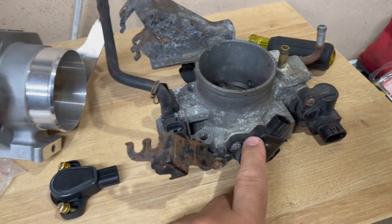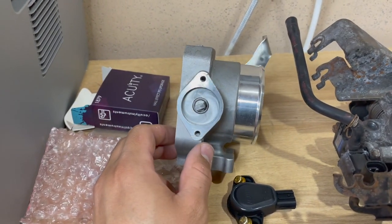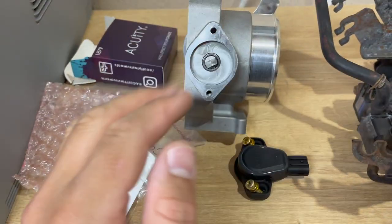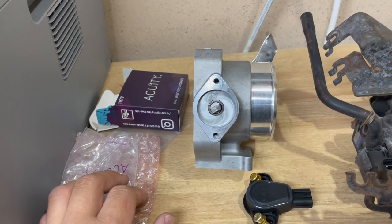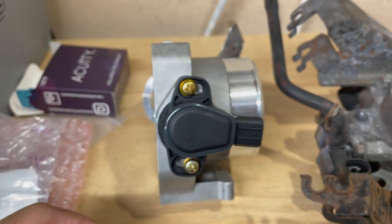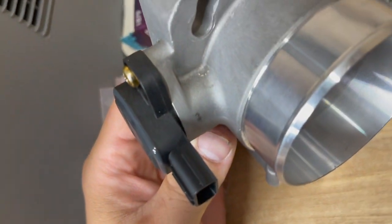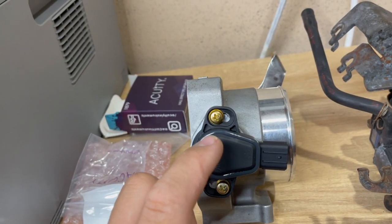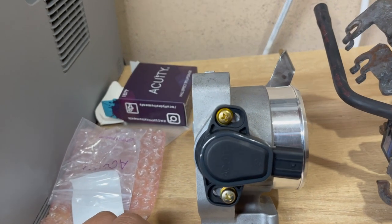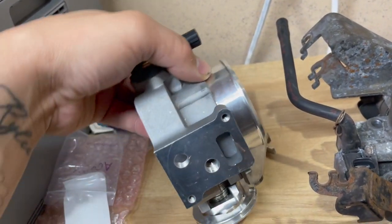This is actually the one I'm running on my RSX - been three years, zero issues. When I tried using the OEM one on my RSX, that's how I found out I needed a new TPS. It was laggy, just wasn't acting right. As soon as I replaced it with the Acuity, everything changed - the car was a lot healthier, running good, made a big difference. So that's how it should look when installed - nice and flush. I'd still recommend getting it to the specs on their instructions online, and then calibrate it on KPro or KTuner, whatever you have for your Honda.